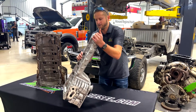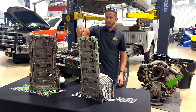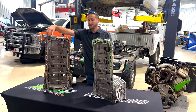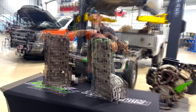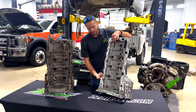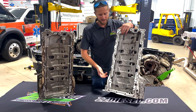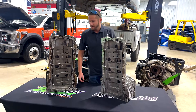We've sold Ford parts for years and never ran into this problem — we just wanted to give you guys some information about what we ran into, hopefully saving some of you from this happening. Another quick way to check: you can blow air through this hole here, or down where your oil cooler would be, and make sure it flows air. Just put your hand over it and feel shop air pressure coming through — that's one quick and easy check we'd recommend.